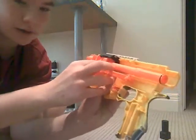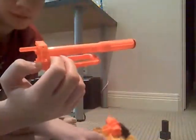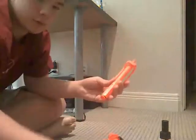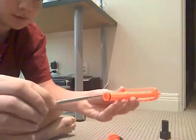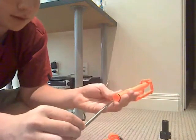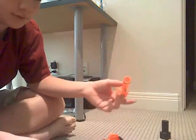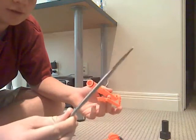At that point you can just slide this part back and lift it out. This is the only part that you really have to mess with. You can't see all the way through because the air restrictor is still in there. So what you're going to do is take a drill bit like this — I use a half inch spade bit, but it just has to be able to reach through the back down to the air restrictor. This is not that long of a bit, like six inches. Basically just get a drill and drill this out. I've seen people use a screwdriver and a hammer, which I think I've done before, but I really recommend the drill just because it's easier. So I'm going to be right back while I drill this out.